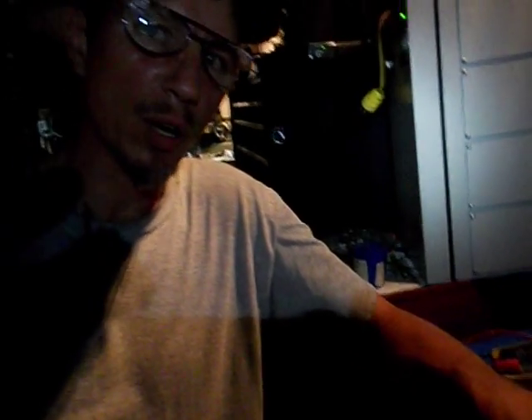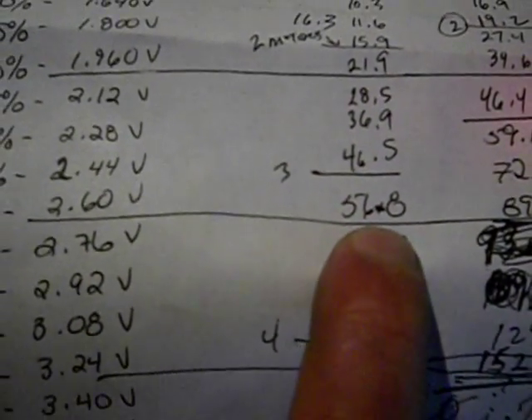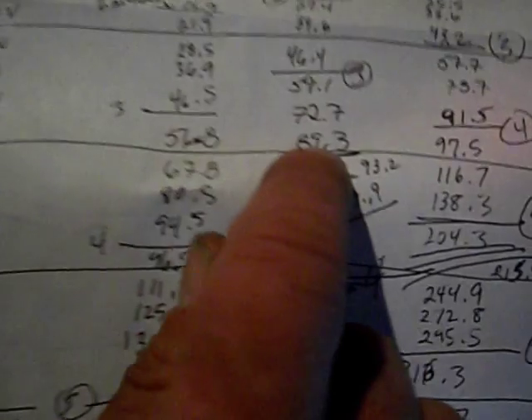Whenever you see standard flow numbers it's 28 inches, so why 25? Because there's a formula that allows you to convert cubic feet per minute of flow into horsepower, so at 25 inches the difference in flow can actually be assigned a horsepower number. Back to 50% flow: 2.60 volts on the TPS. At 10 inches our after number is 58.8, yet our before number was 56.8. At 25 inches we are flowing 92.1 after, but only 89.3 before. And at 40 inches our before number was 97.5, and our after number is 113.